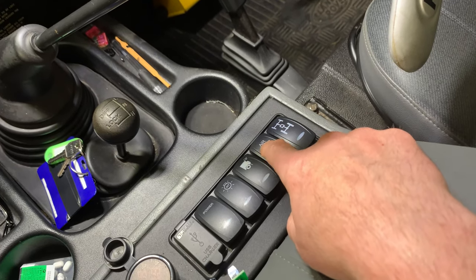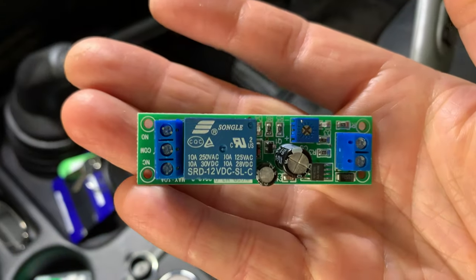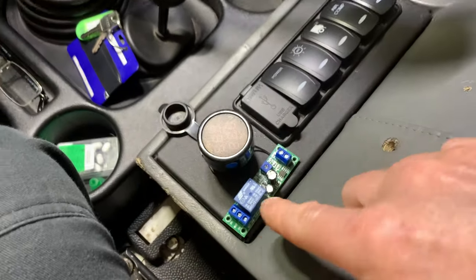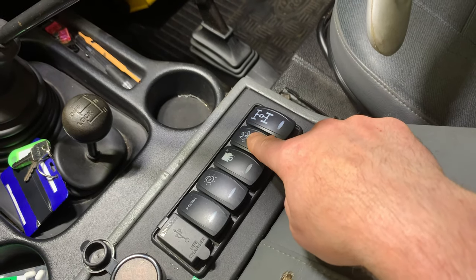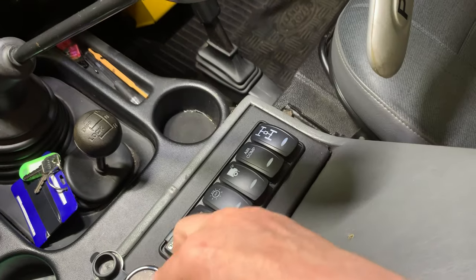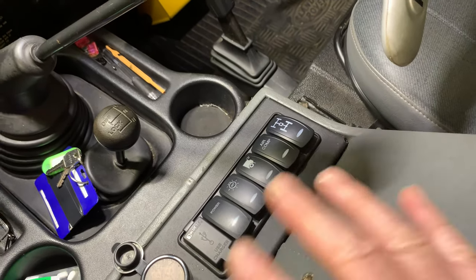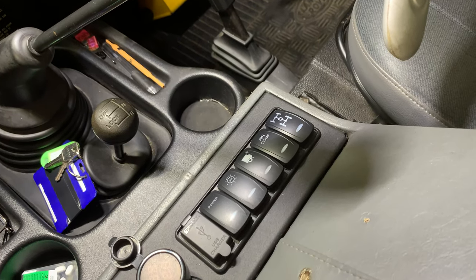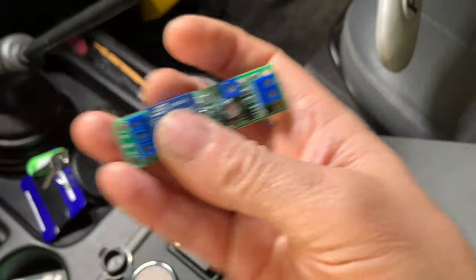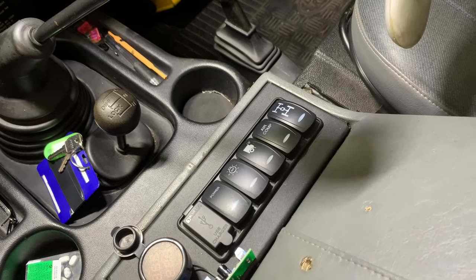The plan is today, so that switch can remain in the always-on position, to fit a purchase I've just made from Banggood — a 5-300 second timer. It's got normally open and normally closed contacts on the relay. I've got to splice it into the wiring so that when you put the engine on, the compressor won't trip in because it's waiting for the timer to actuate. Three minutes into the journey, if the switch is on and the compressor wants air — there's a pressure switch — if it drops below 90 PSI, the compressor trips in, depending on the relay position.